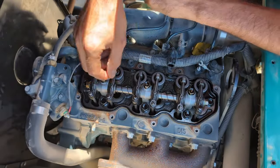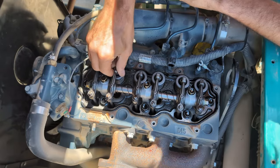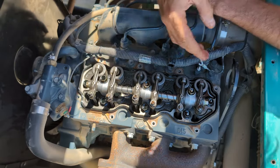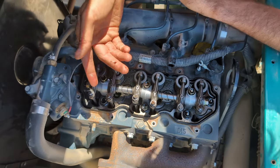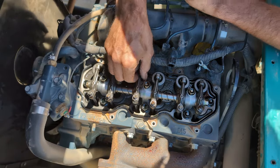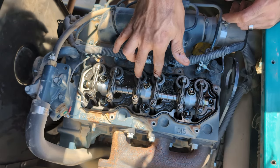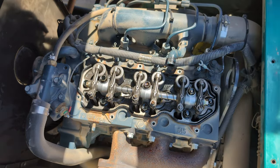At this point, if you're going to do your own valve lash adjusting, you need to have a basic understanding of four-stroke engines. Basically, we're going to look for cylinder overlap and rotate the engine. I know this is intake because it lines up, and this is exhaust — so intake, exhaust, intake, exhaust, intake, exhaust. I'm going to look for an intake that is all the way open. Once this starts to go down, this cylinder should be on its way up, and then once these are both closed, we have compression and ignition — then I can adjust the valve lash on this cylinder. I'm going to actually have to manually rotate this engine over. I want to rotate in the direction of engine movement.